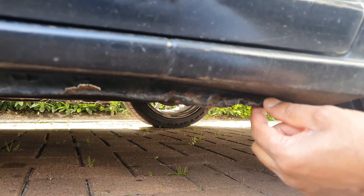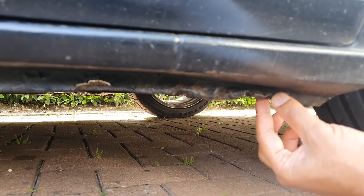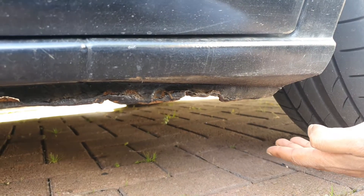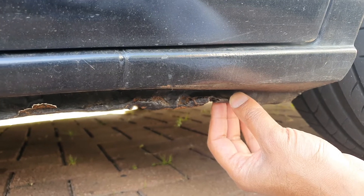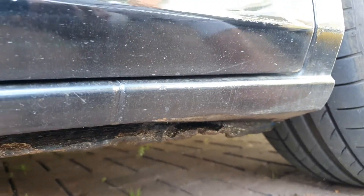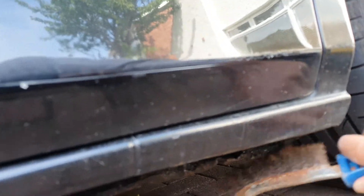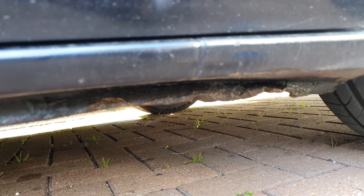The next thing I'm going to be doing is hammering this section down. The bits which are almost horizontal I'm going to knock down so you get a little bit more vertical displacement. You can see it's pretty well horizontal just now and what it needs is to be vertical, so when I use a vise to grip onto it and squeeze it all down it'll go nice and tight. I'm now using this metal brush to remove any loose rust and I'll spray it down with water then reapply some more acid rust remover.